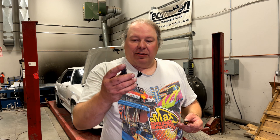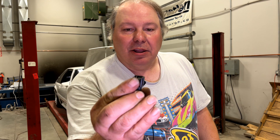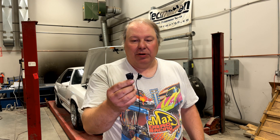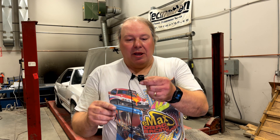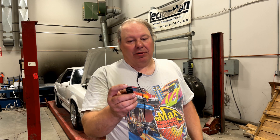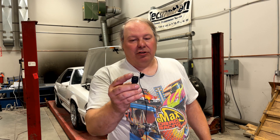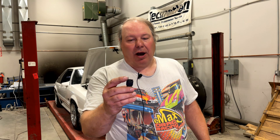When it comes off, that cylinder will go dead. Here's another example — this is super typical on Fox bodies. It's got one tab, but the other one's broken off. If your harness is like this, you can make it work: when you click it on, use a zip tie to hold the other side down and keep it in place. But if you don't, you risk having it twist and pop off.